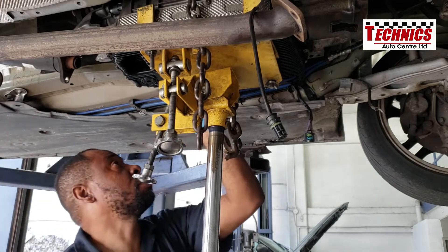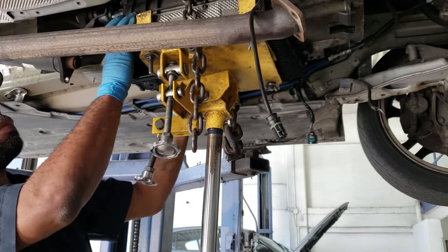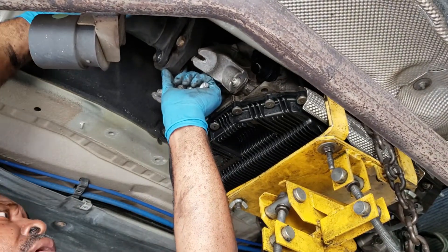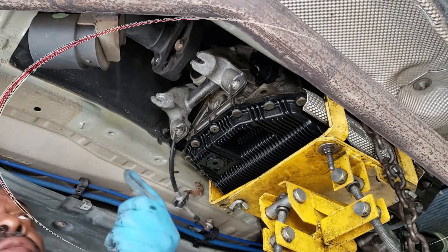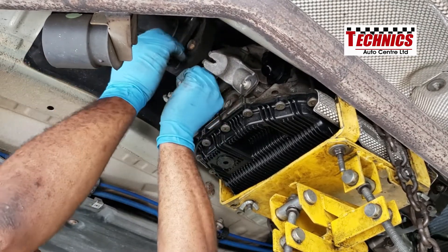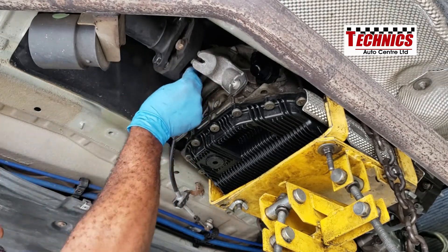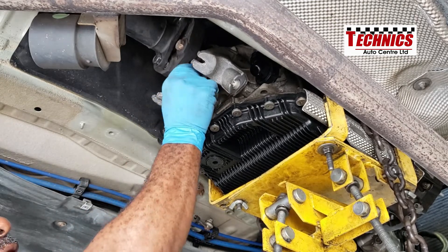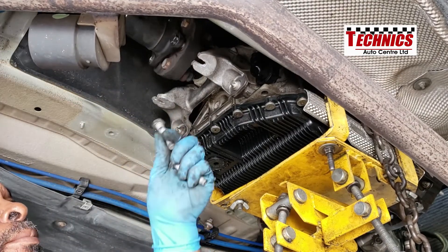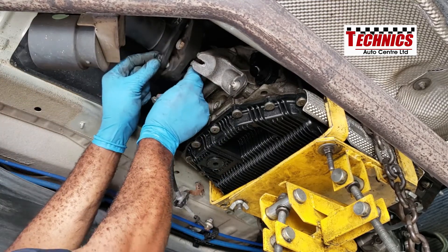We'll just come over just a touch. We're kind of doing it the opposite way when installing the driveshaft — normally we would have the driveshaft out. But because the engine is out, we have the room to move the transmission forward as much as we like. So I'm just going to catch the driveshaft up and then catch the mount up. This gives you nice clearance instead of fighting through the bracket.